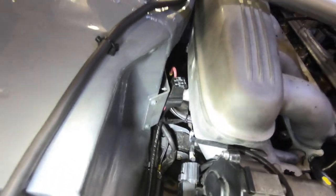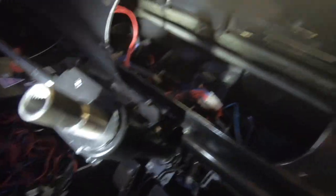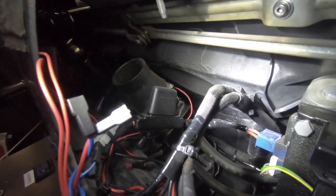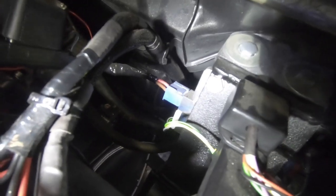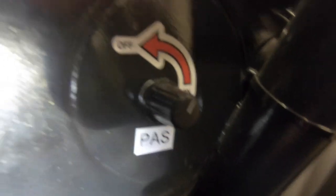I don't really need to show the bottom piece in the engine bay — it's pretty much how it would be on a normal Escort. I've got a Group 4 knuckle and then a spline shaft, just one shaft bolted in — straightforward. The wiring is as simple as it comes: four wires. There's a big blue plug which is heavy-duty power, with around a 30 or 50 amp inline fuse and a big heavy earth. Then there's a Rick's Engineering power steering controller — that little black box.